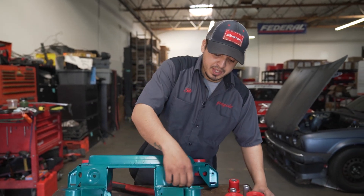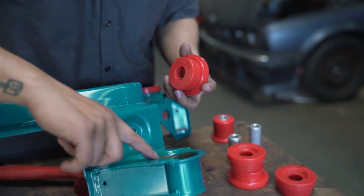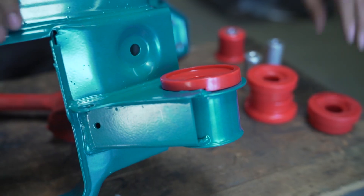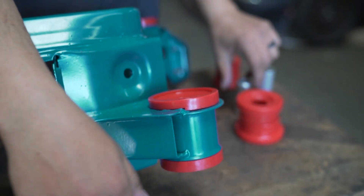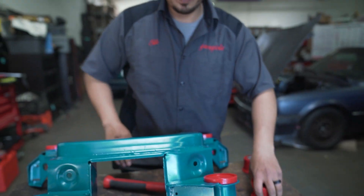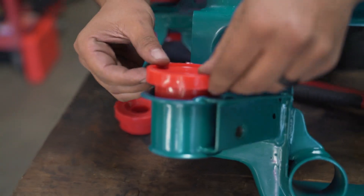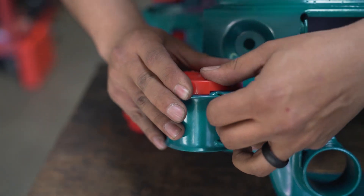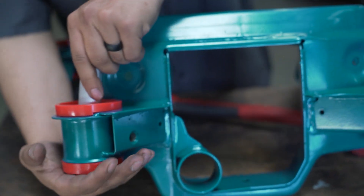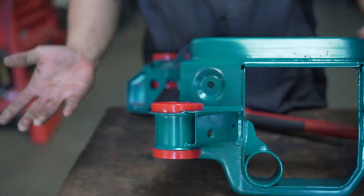For the front one, on the top bushing we actually have a grooved part on the bushing to sit in place of the weld. So you'll just line that up with the weld, push it in — done. Take the bottom one, push it in, then seat the race. For the other side it's the same thing: line up the little groove with the weld, push it in. Take the bottom one that says lower front, put it in, then the race.